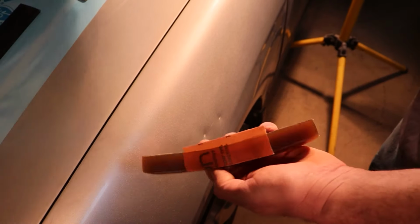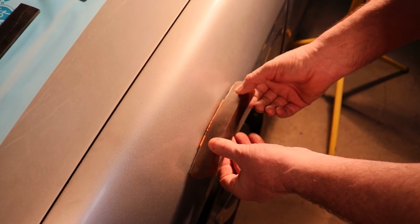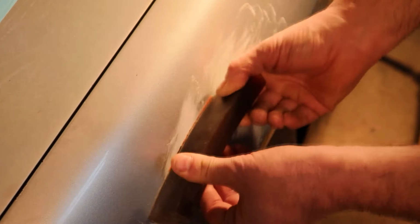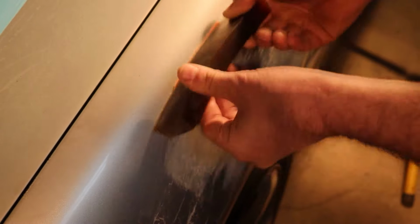some of the sandpaper. We don't have to paper the whole bottom of the block, so we can just stay on that dented area. So let's just sand that a little bit and just expose the lows and highs of these two dents that we put in here. Oh, there's another dent up here. See that? The block easily exposed what was wrong there.